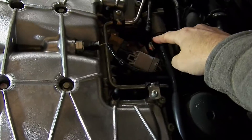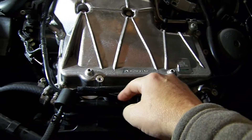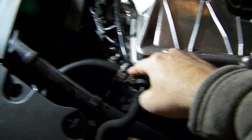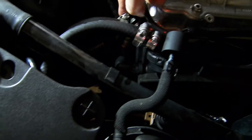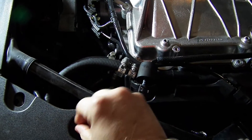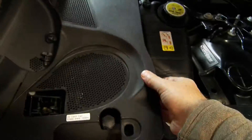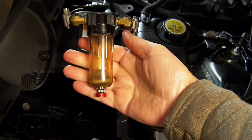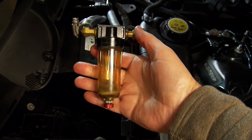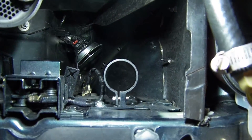Here on the right-hand side of the car, we follow the hose from this portion of the intake. This is the low-pressure ventilation pipe. And over here, it was cut such that I could add these two hoses, which then go to this catch can on the right-hand side of the car. And this catch can does collect a fair amount of fluid. It was the same bracket that holds it on this side with a threaded hole.